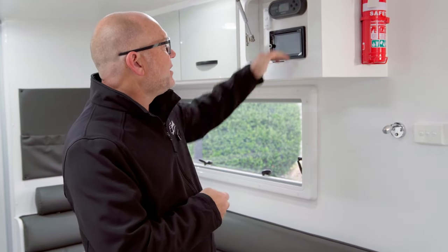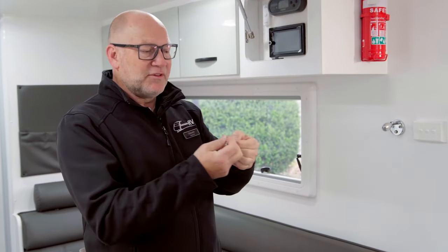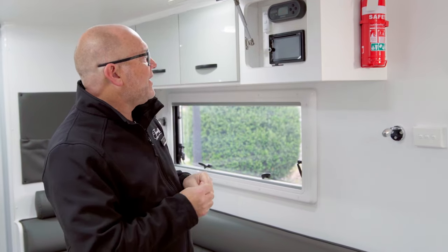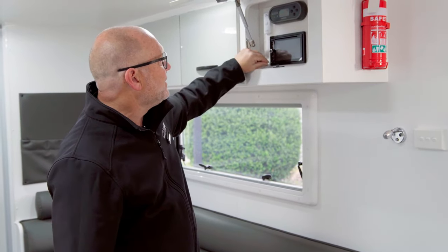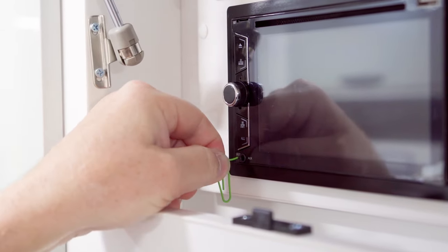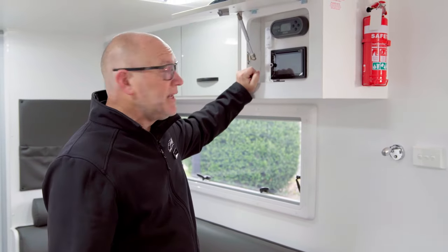Carry with you a few paper clips — they can sit in a little cavity up there. I have a green one; yours doesn't have to be green, we just used it so you can see it easier on the video. In the bottom left-hand side of your radio fascia there is a little reset button. Get your paper clip into the reset button and push it all the way in.